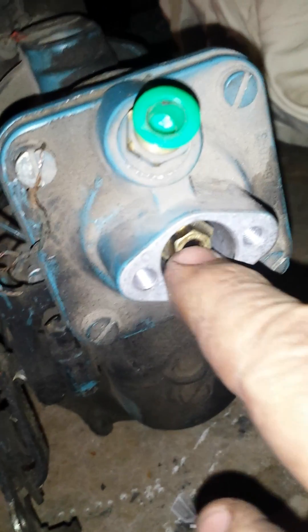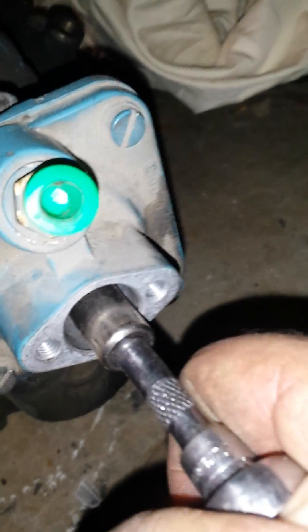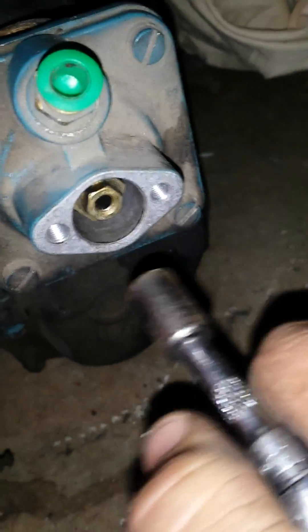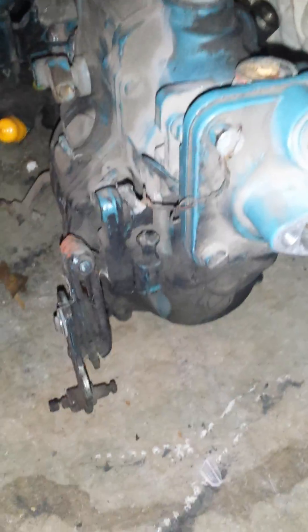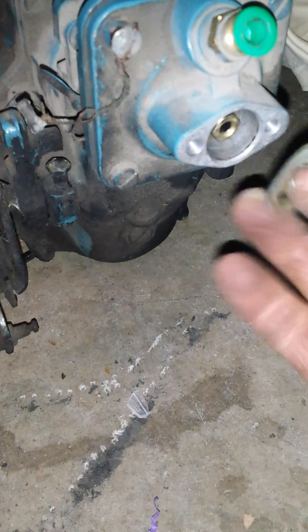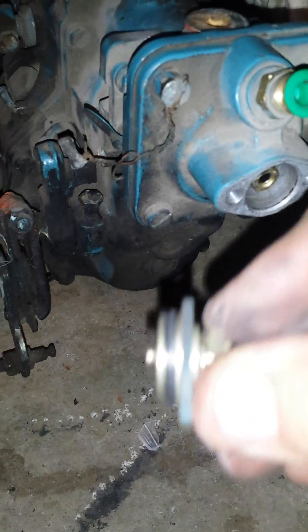Right about flush with that stud is roughly just over 19 millimeters of rack travel, which is what all these pumps are good for. They're not really hot rod pumps, but they can move a pretty good amount of fuel. This is your stopper — don't mess that up; I've got the O-ring in there.